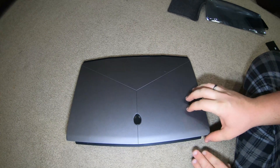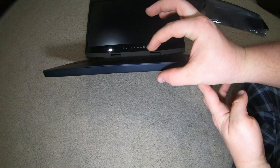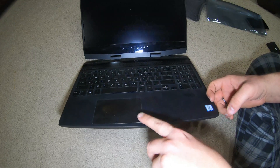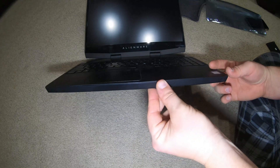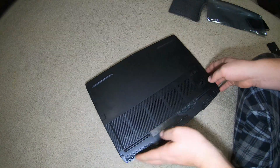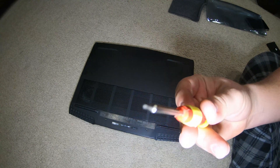My issue was my battery is actually imploding inside, bending things up, and it's almost taken out my touchpad. Sometimes the right clicker doesn't even work. In certain climates that I'm in, this starts to have very big issues. So we just did the unboxing on the battery, now we're going to install it. The only thing you need is a very small Phillips screwdriver.